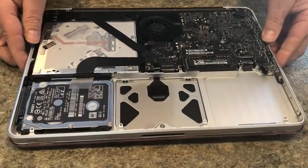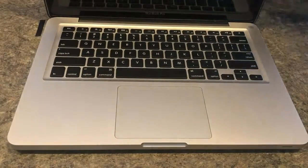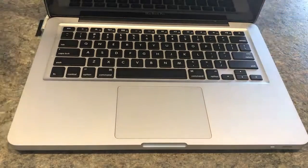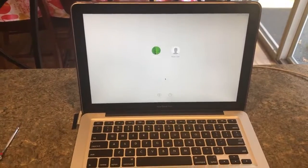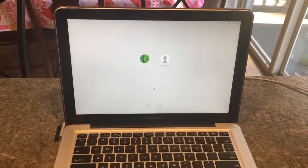Now let's try powering on without the battery to see what happens. We're going to plug in the power cord. Make sure there's nothing metal in the way so it doesn't short out. Let's grab our power cord and plug it in. Got power and I can already hear it turn on — that is awesome! So we know it turns on without the battery. It could be a battery issue, or it could just be that it had a voltage spike of some sort and was holding that voltage in the system, and by removing the battery it depleted it.